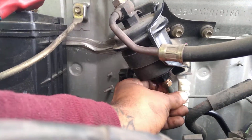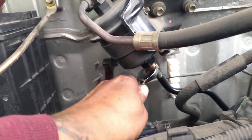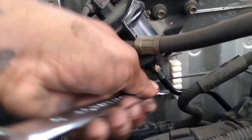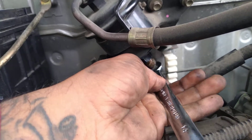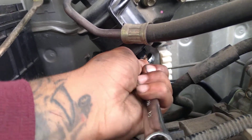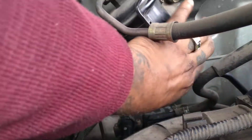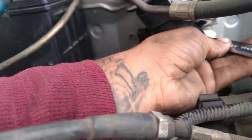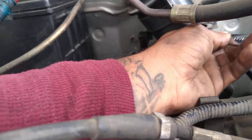I'll undo it all the way — I'll tell you when I turn the key. We've already loosened it up. This right here is a 14 millimeter. Let's tighten this up. This is also how you'll change the fuel filter on the Honda CRV with the 2.0 — this is a '99 model.